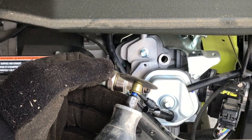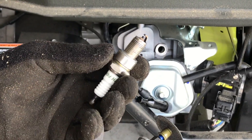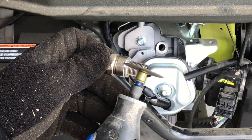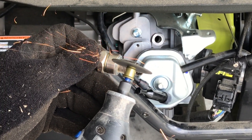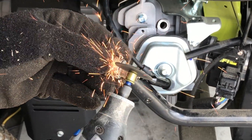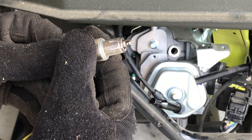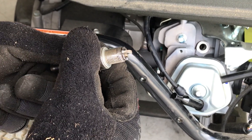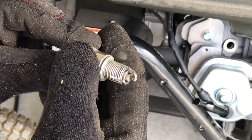What I'm going to do is cut four grooves in here — essentially I'm taking my spark plug and creating a tap. I've got four grooves now. These aren't quite as wide as a regular tap set, so we'll see if these work as is, and if they don't we'll widen them up.